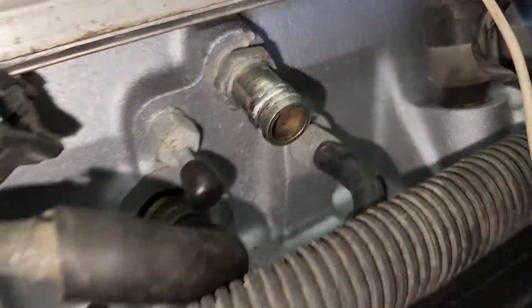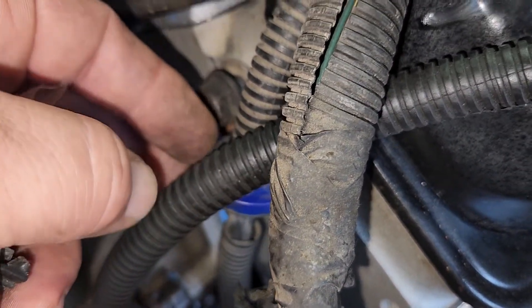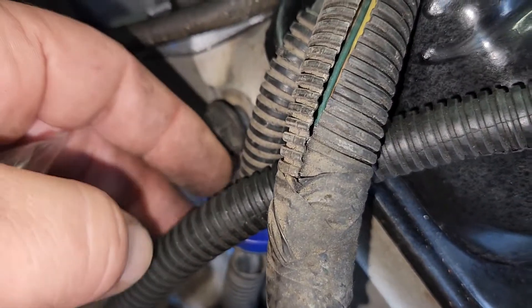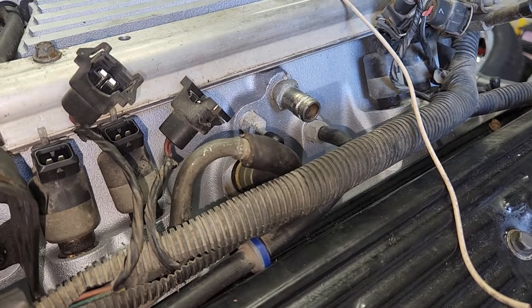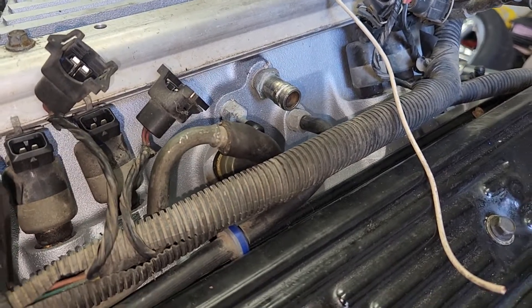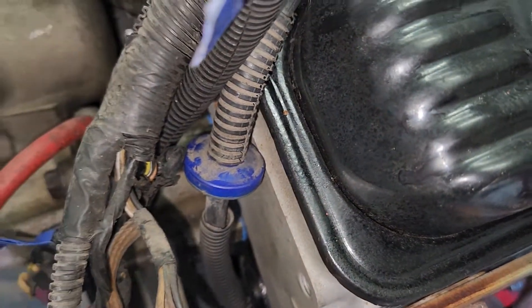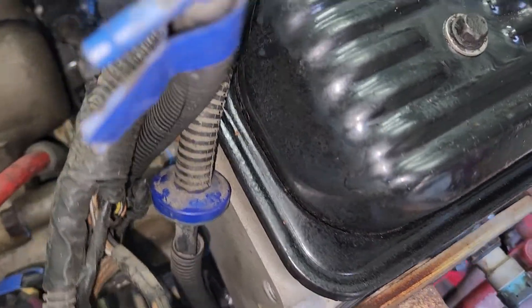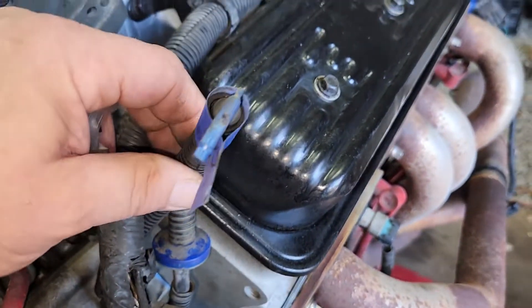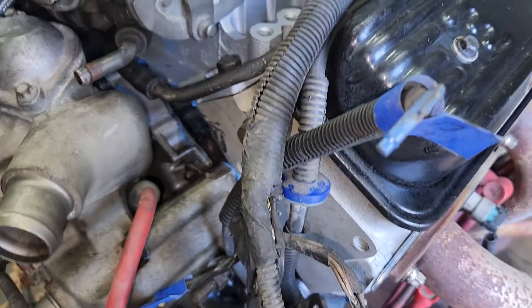This vacuum port runs down to the Opti - it's got a one-way check valve in it so it can only suck and not blow back through there. Because when you go at wide open throttle and you've got blow-by, it'll blow back down through there. And that check valve is there to keep oil from the blow-by from going back inside the Opti, so it can only suck out of the Opti to help keep the Opti clean. Also another line that comes off the Opti is right here, and it goes into your air intake stream - it just plugs right in. That's for the vented Opti. The non-vented Optis will not have that.